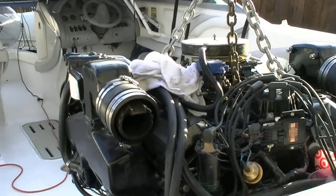That's what we're doing today. I'm going to get back to work and I'll update you later. The engine is aligned. It took us right at about two and a half to three hours. What we kept running into is kind of a comedy of errors — you'd get it all aligned perfectly and then you'd tighten down another bolt and all of a sudden it'd loosen it. We rotated the engine 90 degrees and then it was messed up. You've got to rotate the engine, test it, rotate the engine, test it, tighten down all your bolts, test it. It's just a matter of getting it just right, and it takes a lot of time and effort.